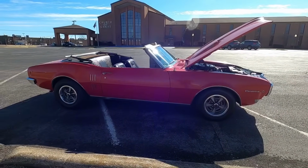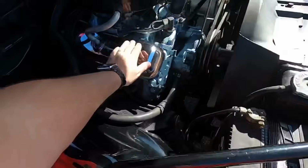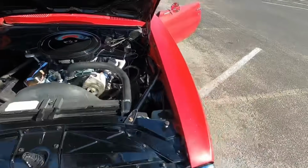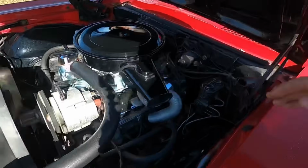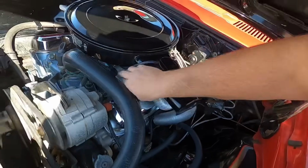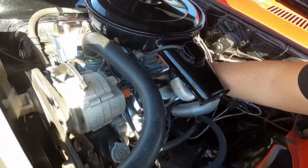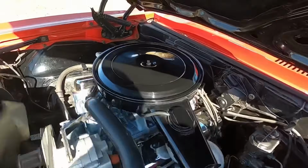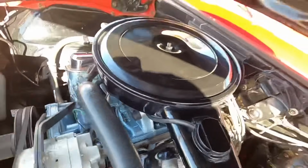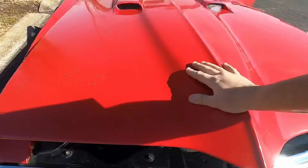Okay, so that choke is not kicked off yet. That motor's warm. I mean, it should be kicked off by now. Tried a little bit of everything. I'm gonna unplug it. So you unplug that box right there, that wire that I just took out of it. She's down now. Much better.